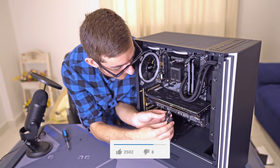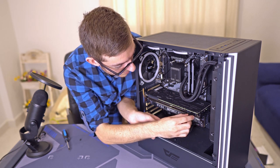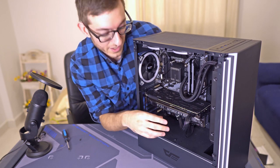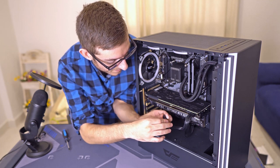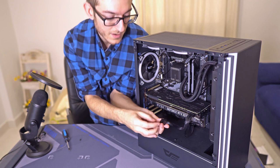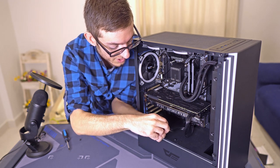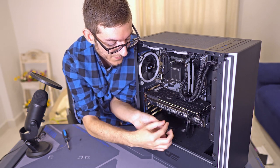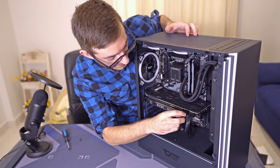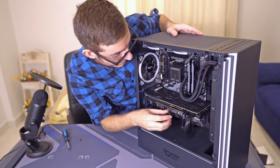So let's go ahead and plug these in. Stick this one here — you'll feel that it's in all the way. Some of the 8-pins, you can actually remove two of the pins to fit in the 6-pin slot. You slide it up and out like that, and now we have a 6-pin from an 8-pin. There we go, it's plugged in — just like that.